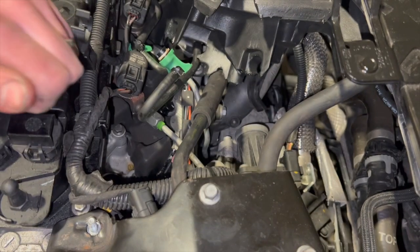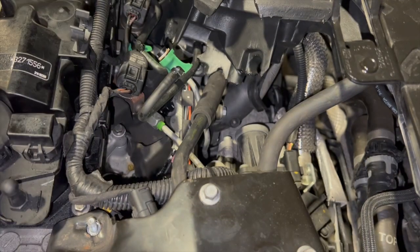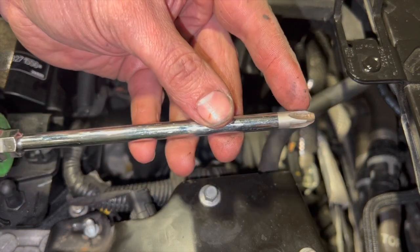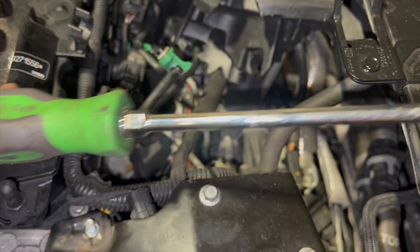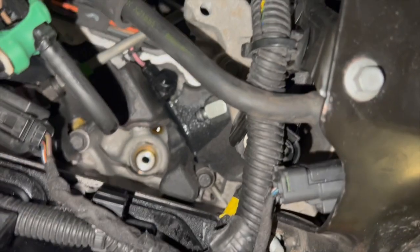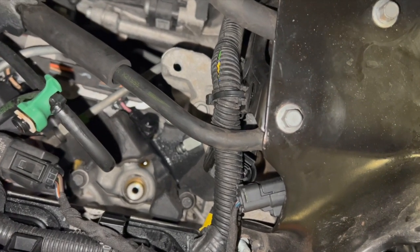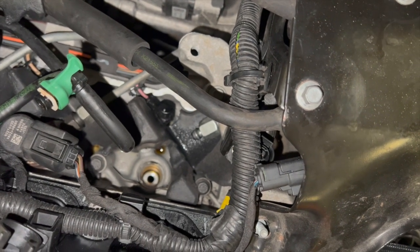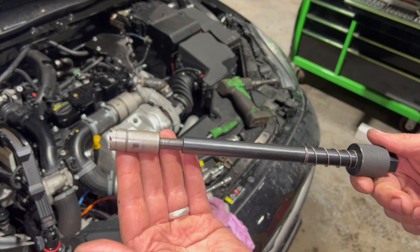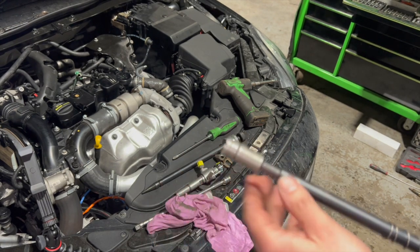I'll show you quickly how the seal removal tool works. Basically you just slightly twist it in and then use the slide hammer function to pull it out. If you didn't have that tool, another way that works quite well is a Phillips screwdriver — just tap it in, it grabs the copper and you can normally get away with that if you really need to. Have a look down the bore — it looks really clean, that doesn't look too bad at all. I'm going to give it a bit of a wipe out in the hole. I just gave the bore a little clean with this tool — only really need to work it really lightly, just cleans up the very bottom seat — and then just give it a quick wipe round with a rag.